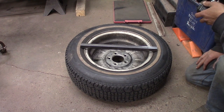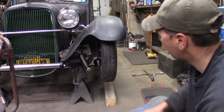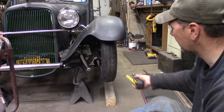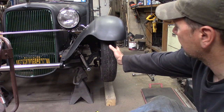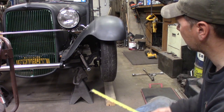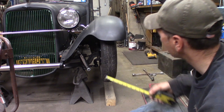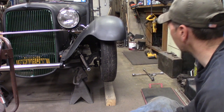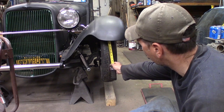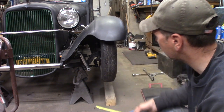We'll go with about a four inch backspace. The backspace is important when you're picking a wheel because it determines how much of the rim will be on the inside of the hub face. This donut spare has a lot of backspace — the rim is almost all the way to the back — and it's not centered up in the fender, so it wouldn't look right. I'm looking for something smaller in width, about four and a half inches section width, maybe a 15 by 4 rim. The big wheels are 15 by 6 with a two-inch offset on the outside and a four-inch backspace on the inside.